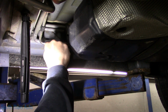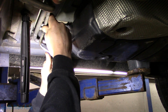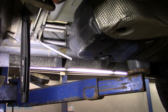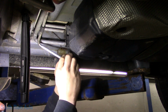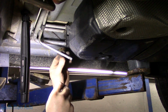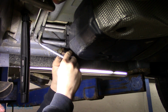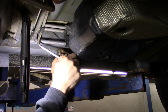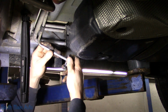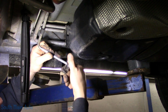So why don't we do this? Okay, this is soft aluminum. We're gonna just very gingerly tweak that down, okay? Now where you chopped it off with a saw, you gotta clean it up with a pipe cutter. And then try to avoid using chemicals to clean it off, because brake clean really raises heck with the old gas sniffer. If you want to verify that you don't have a leak when you're done, don't use brake clean. I know you probably never would have heard those words uttered from my lips, but stay away from the brake clean in this case.